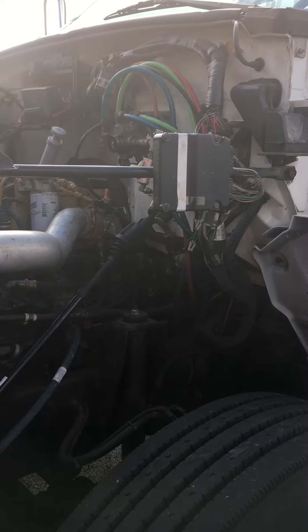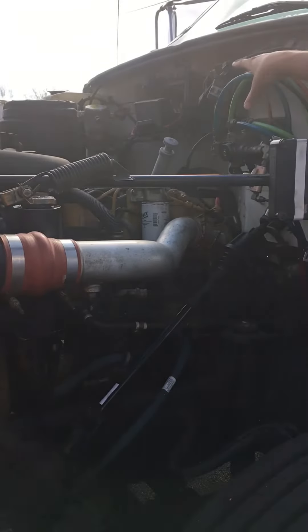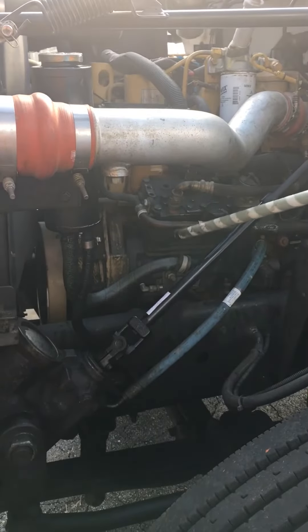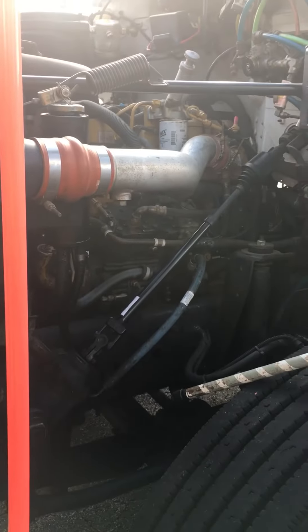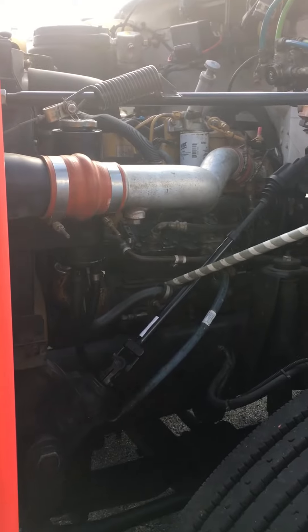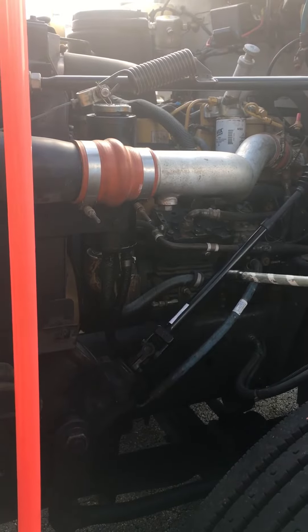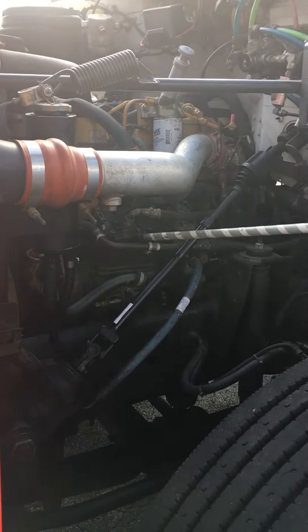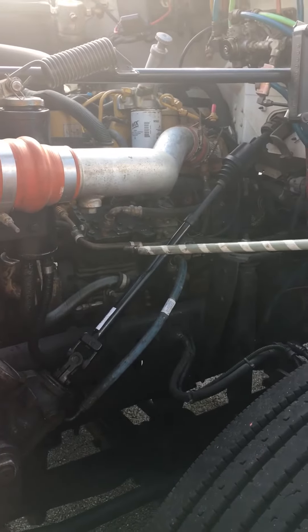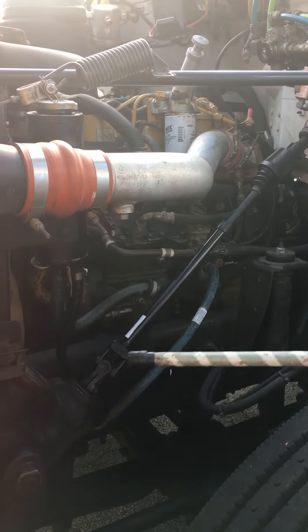So I've got my belts, dipstick, airlines, and wiring. Now I'll come over to my gear-driven air compressor. We say 'gear-driven air compressor' as a memory aid to remind you it's gear driven. Make sure it's properly mounted and secure, not cracked or broken or damaged. We're also going to listen for leaks on the compressor itself — separate from the airlines coming out of it.